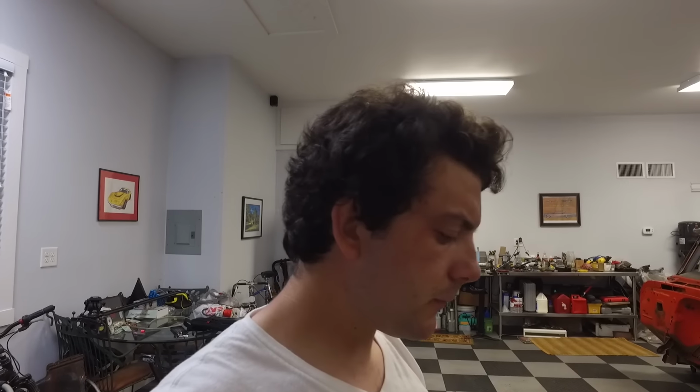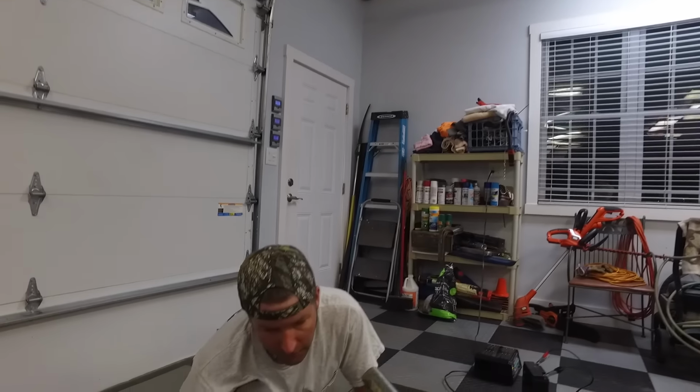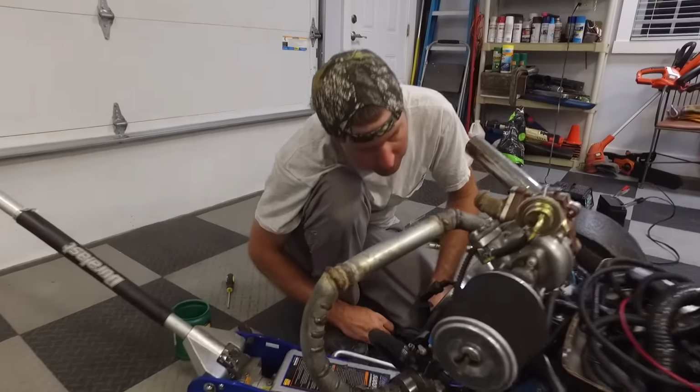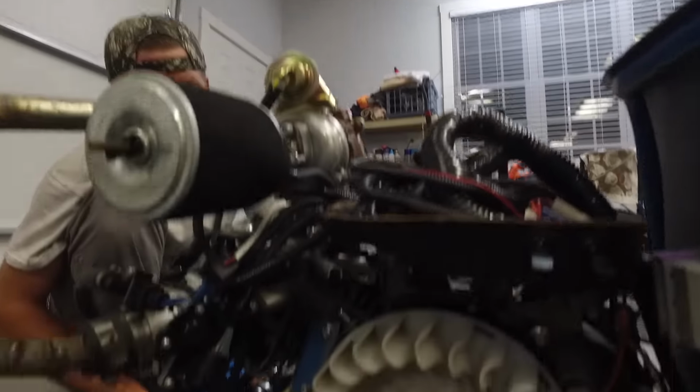I've been working on the fuel system, more specifically the fuel lines. We had to switch the pickup and the return. So the pickup is now at the lowest part of the gas tank. Ike has been working on relocating the hall sensor. And I don't think he knows if he did it right or not. No, I'm pretty sure I didn't. But you know what? It'll be fun.